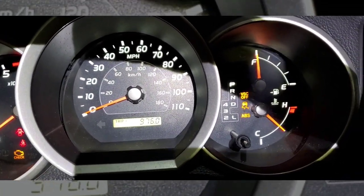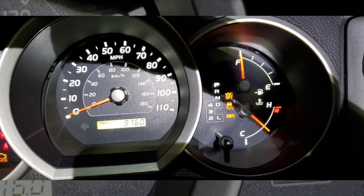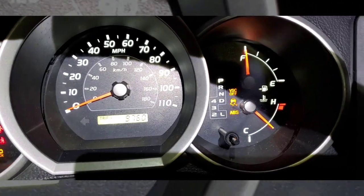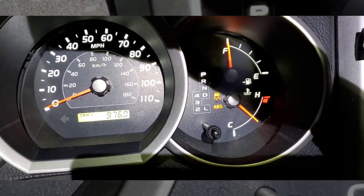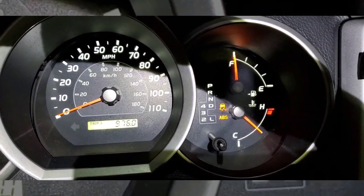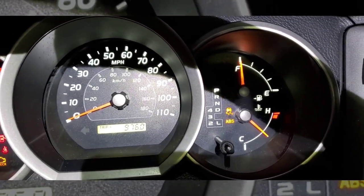The problem with these — there's a few different things. One of them could be the gas cap; you just got to replace the gas cap and this could go away. In my case I've done that and it's still there, so the next step for me would be the front speed sensors.